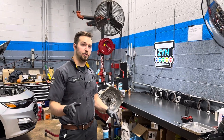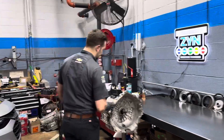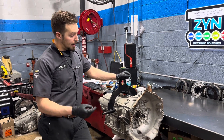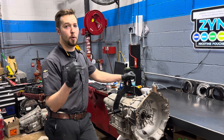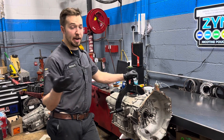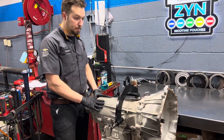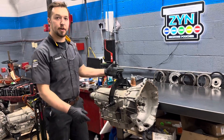We're back and this is going to be a 6L90 disassembly or teardown. This unit is out of a 2020 Chevy Express Van 3500, 6-liter gas. It has no forward, no reverse, no apply, no engagement, no nothing. The fluid is in great shape and there are no check engine lights on. I suspect something is broken in the output of the transmission because I have input speed signal. We have it mounted in the fixture and we're going to start tearing it down.